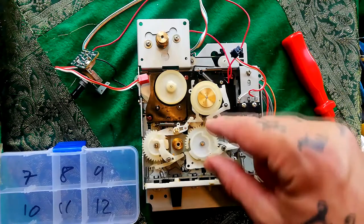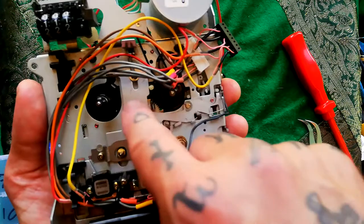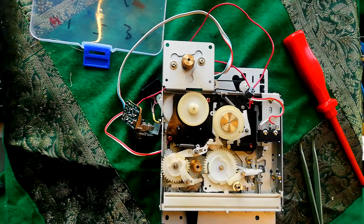This area is basically to do with raising and lowering the magnetic heads. This part here you can see is moving, and that movement is selecting which of the reels is being engaged via momentum creep from the upper part of this pulley.